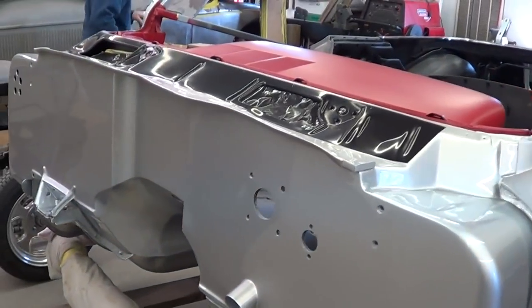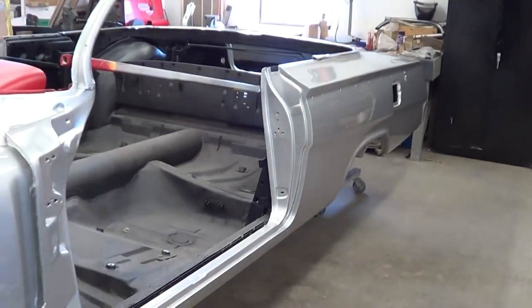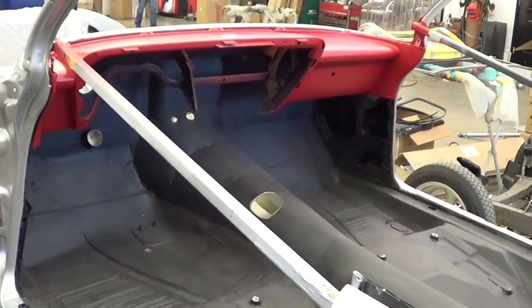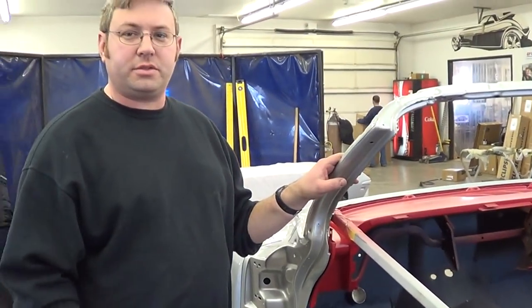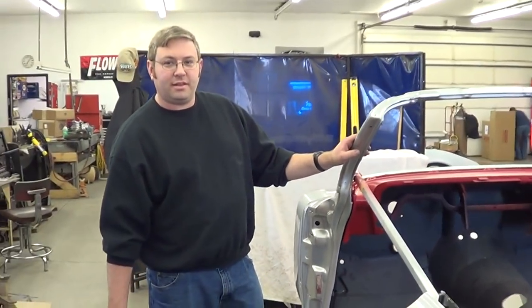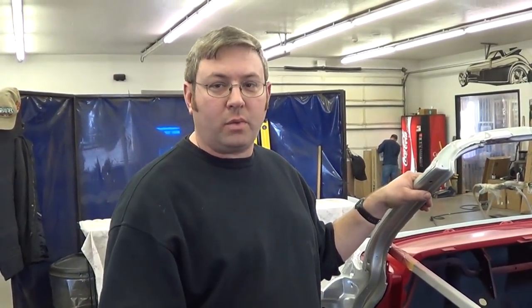Will you have to rub it again? They'll just go over it and touch it up in a few places where it dries out a little bit. Yeah, I was wondering if the solvents will keep coming out where you have to rub it again. It gets out in the sun. How long does that usually go on? If you've got one and you take it outside and it's going to be out quite a bit, how many days in the sun does it take until all the solvents come out and you can get your final buff? Dad will usually go over it right after the first time it's out in the sun and it'll keep it pretty good — there'll just be some little touch-ups through the season. Usually it's real hot down there, so that cures it out pretty good. So you don't have to wait 30 days — this stuff now you can do it the next day, start sanding it, let it cure a little bit, and then the next day buff it and wax it. It's ready to go.